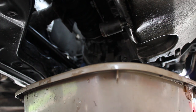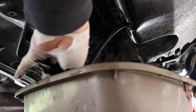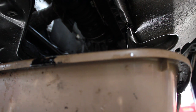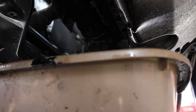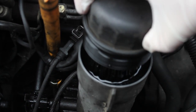We'll speed up undoing the filter — it will come out and it's going to drain the oil from the system, so for any car you're probably going to have the same sort of procedures. The reason I undid the filter first is because you don't want to get to draining your oil and then not be able to undo your filter. Unfortunately, being the type of cap this is — plastic, unlike the throwaway metal one — if it is stuck you can't use a hammer and screwdriver on it, so just want to make sure that undoes first.